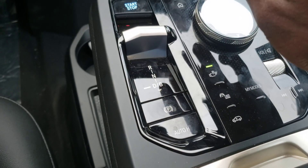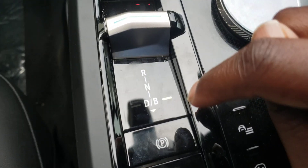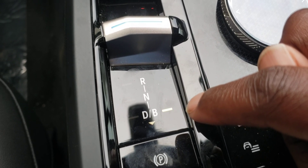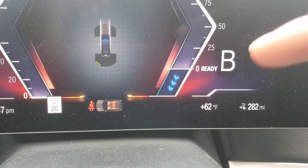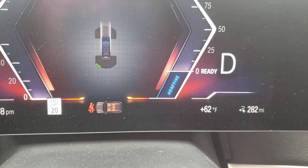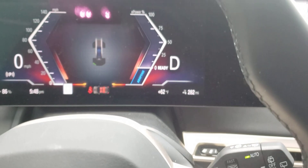If you go down and put the car in Drive, you're in D. Pull again and now you're in B — that's engine braking and also your most extreme recuperation mode if you want to jump straight to the highest recuperation. You can see the indicator at the bottom changes. Let's put it back to Drive Adaptive — you can see the D here — and then back to B, recuperation all the way high.